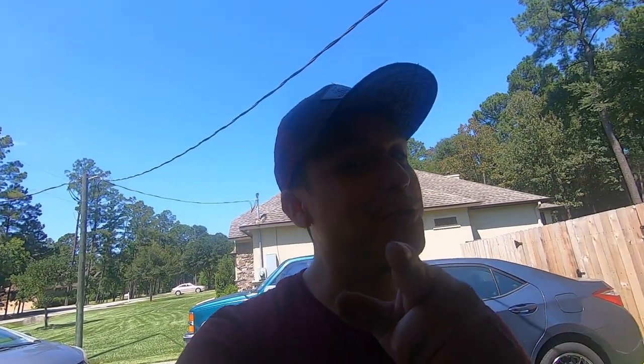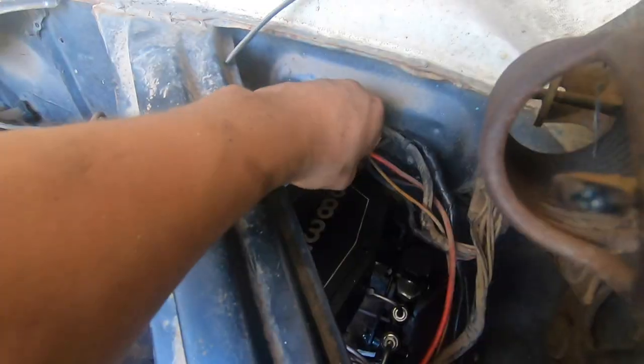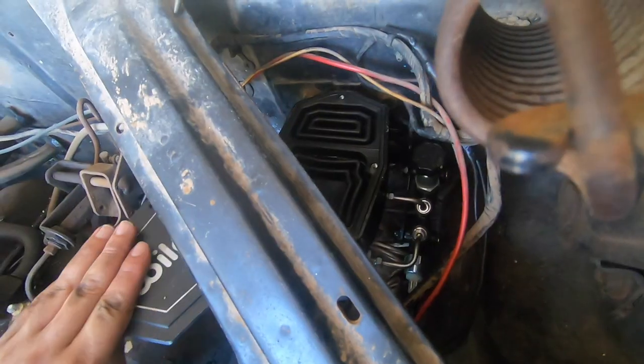We still have so much to do, so I'm not going to let that hinder us. Now we have to bleed the whole entire brake system. After that it's put on the new wheels and we're good to go - take it out for a spin. The general rule of thumb for how you bleed brakes is to start from the furthest wheel from the master cylinder. In this case that's the passenger side rear tire, then the driver side rear, then passenger front, then driver's front.